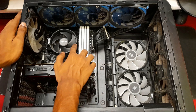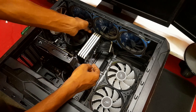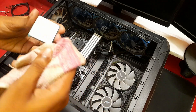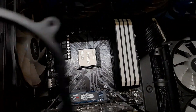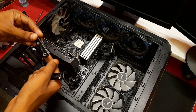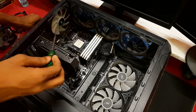It's finally time to install it onto our PC. I have a Ryzen 5 2400G with a stock cooler, and I'll be installing the Ant Esports cooler onto it. The first step is taking off the existing cooler, and the most important step is cleaning the old thermal paste off the CPU. These four holes on the motherboard do not align with any of the mounting brackets included, because those brackets are for Intel-based motherboards, not AMD. For AMD, you need the stock mounting brackets that come default with your motherboard, and I have those kept with me.